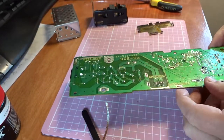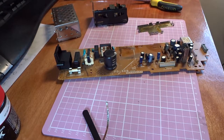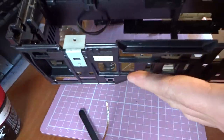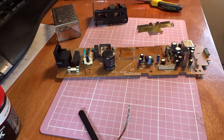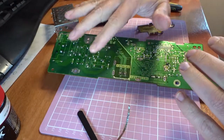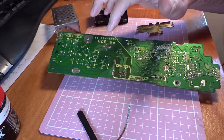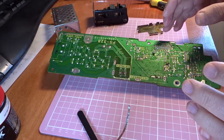We've managed to pull the power supply board out of the unit. It just comes out separately. That's where your power supply comes in. The board just had a couple of connectors on the front and one on the back. We actually plugged it into the power supply and I was very careful not to touch anything on the primary side. I measured the main capacitor - it was charging up to 330 volts and then slowly discharging. So parts of this are working.